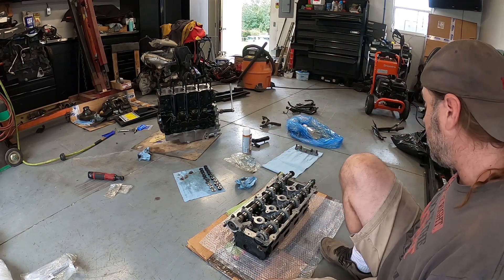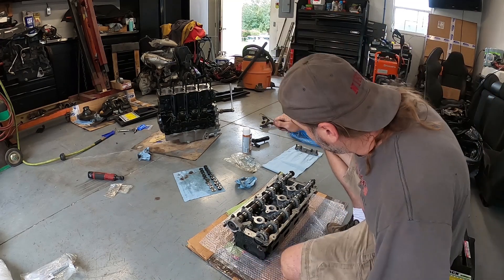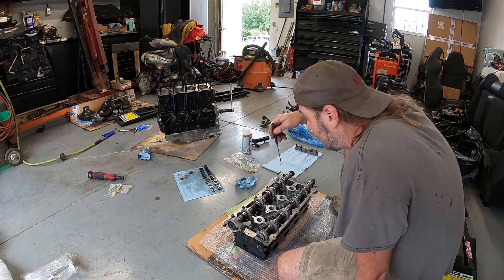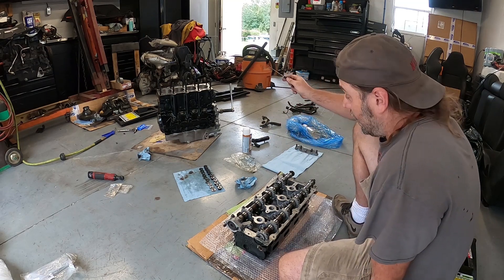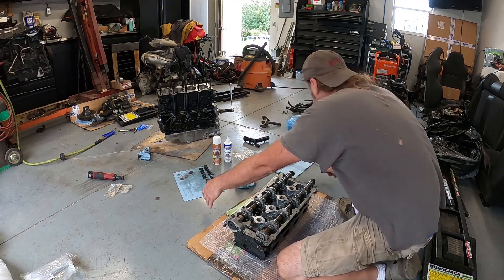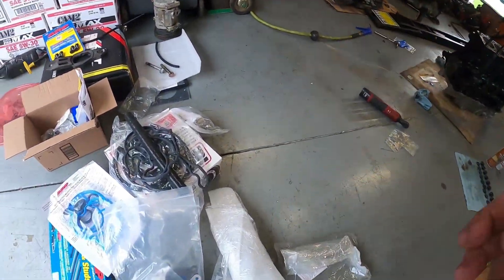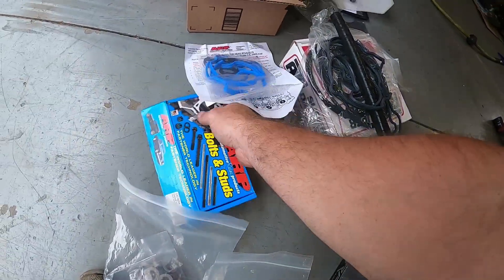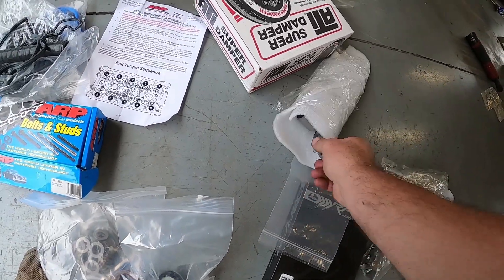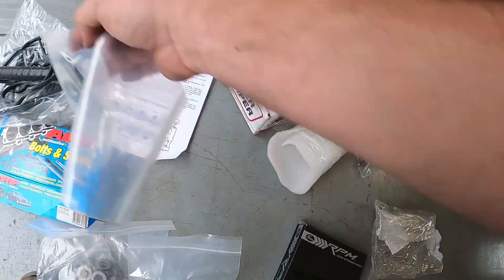This stuff here needs cleaned up just a little bit on this cylinder head. The mating surfaces are really nice. Right now I'm getting these cams pulled out, setting everything off to the side, looking everything over. I have copper spray gasket, assembly lube to coat my cams. Here's our ARP stud box with instructions, all kinds of gaskets, and the timing kit right here.